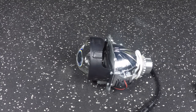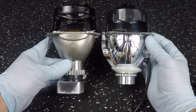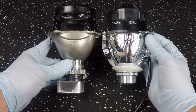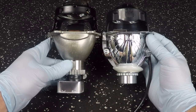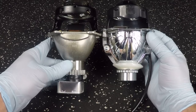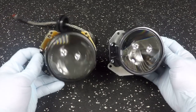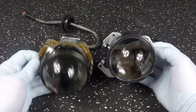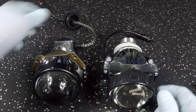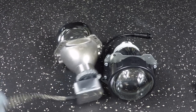I've got an HID setup right here — this is the Morimoto D2S. You can see they share a lot of similarities. That's got the bulb attached to it already. With the igniter on there, it's about three-quarters of an inch longer on the left-hand side. If we remove the threaded shaft, we're saving about maybe an inch and a half. The front is a little bit different too. So a lot of space savings with this unit. It's got the same mounting pattern and bolts and everything. With HID, you have a HID bulb, you've got an igniter — this is a D2S igniter — and then you have a ballast.